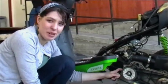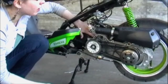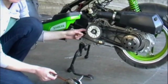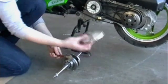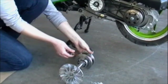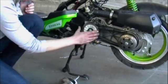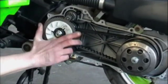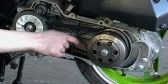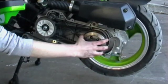Next I'm going to show you how the engine makes your wheel turn. This is a crankshaft. The crankshaft is inside right here — it's attached to the piston, which is inside the engine, as well as being attached to the variator, which is right here. This is also a variator, and it goes just like this. As the piston moves up and down inside the engine, it spins the variator. As the variator spins, it turns this belt. This belt is attached to this piece, which is called a clutch. As the belt turns from the variator, it also turns the clutch, therefore turning the wheel.